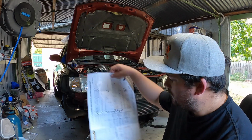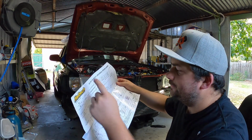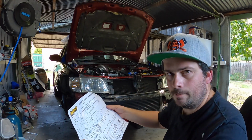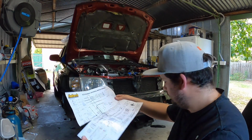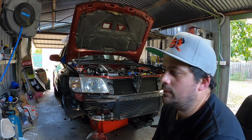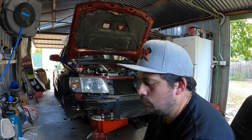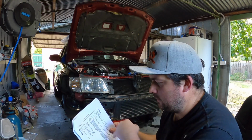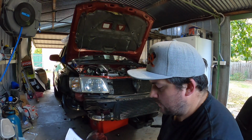Alright guys, so I couldn't connect my OBD to find out what's going on. Well, at least we know this is what we've changed. So, what do we need to do? By the looks of it, throttle position. I'm not sure if I can just take that from the Haltech because it's still putting out a 5 volt, or if I need to go into the ECU for the ECU to do something, put it out to the transmission.